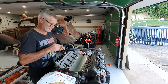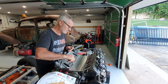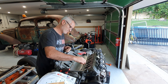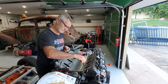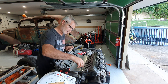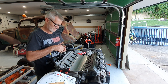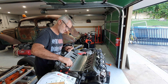There's a significant difference in the look of this valley cover compared to the stock one. I did mention in a previous video that I wasn't going to change this over, but it's kind of interfering a bit with my vacuum lines that I just installed under the injection runners. So I figured I'll get this as neat and tidy as I can — plus I don't have to plug off that vacuum port as well. I'm going to put a different scavenging system on this engine.